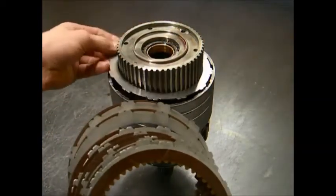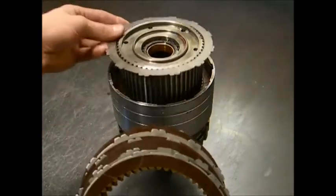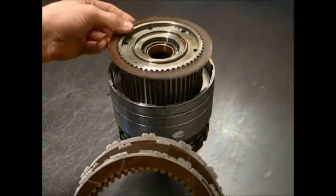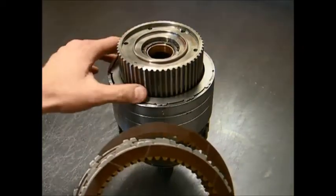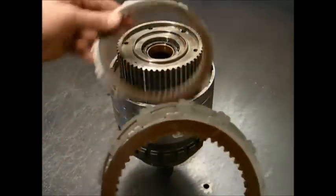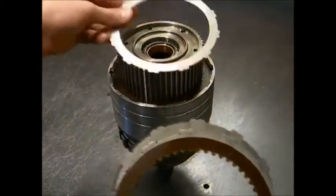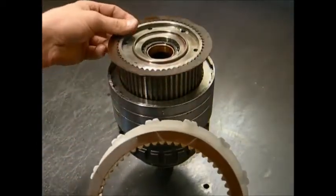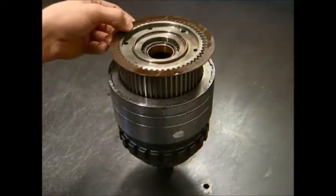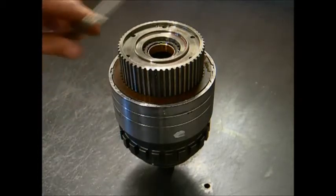fiber, steel, fiber, steel, fiber, steel, fiber, steel, fiber, steel, fiber, steel, fiber, steel, fiber, steel, fiber. Before going to the press, you'll want to install the apply plate with the flat side down towards the fiber